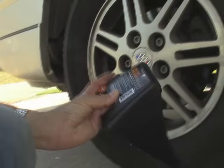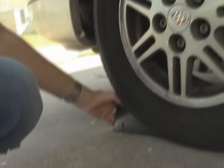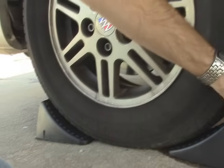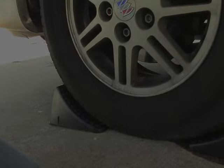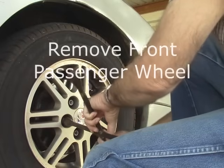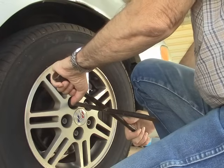Get the car up on jack stands. We have these — what they call heavy duty wheel chocks — and what we want to do is put these behind the tires to keep the car from moving any which way. If we're trying to tighten or loosen a bolt or nut, we don't want the car to slide back when we're underneath it. To get to the power steering pump, we have to move the tire, so next we have to loosen the lug nuts.